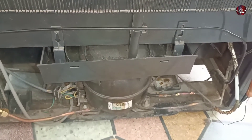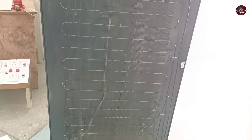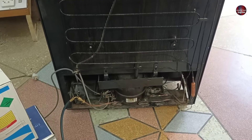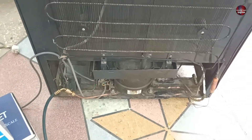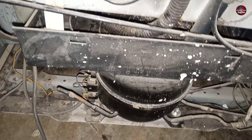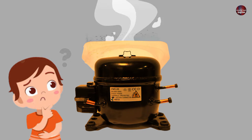Now for increasing the refrigerator's efficiency, there are many other ways to do it. Most of the refrigerators in our homes are air-cooled refrigerators, cooled through the air, not water. Most of you would be thinking why the water drip tray is installed in refrigerators. The refrigerator drip tray, also known as a drip pan or defrost tray, is designed to collect and contain any water that may accumulate during the defrosting process. Then the process of vaporization starts to occur. Vaporization in the water tray occurs because when the compressor works, it also warms up. Due to the heat transfer, the water also gets warmer, which starts the process of vaporization, and this way the water evaporates from the water drip tray. And we think, how does the water disappear inside the drip tray?